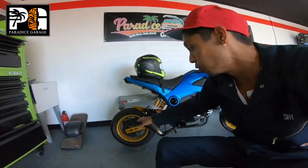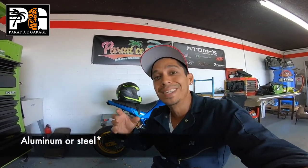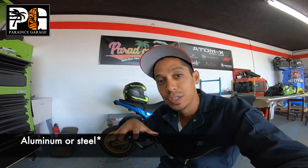So we're gonna be doing the aluminum rims on here, this part of the bike, okay? A lot of different pieces. It doesn't have to be rims. It could be body parts, cars, hoods, whatever. And you're gonna wanna make sure to spray these things with an epoxy primer to seal it, and then you're gonna put a 2K filler primer on top of that.